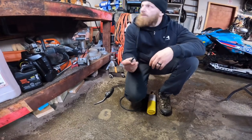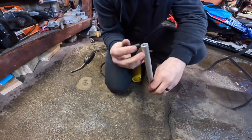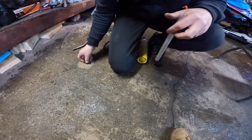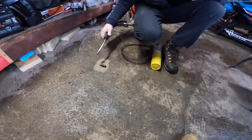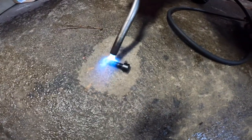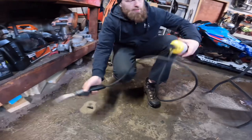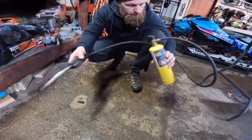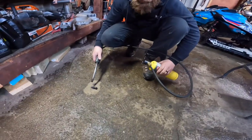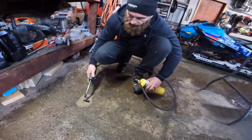So when you take your skid apart, items like this little cross piece here, they got some Loctite in there, right? And when you take it apart, you're gonna see that there's some in there. And I found that if you take a torch and heat up the bolt with just a regular little home do-it-yourself torch, like from Lowe's, you can actually cook off all the Loctite. So it's nice and clean, so that when you go to put Loctite on it, you get the maximum amount of surface area out of it.